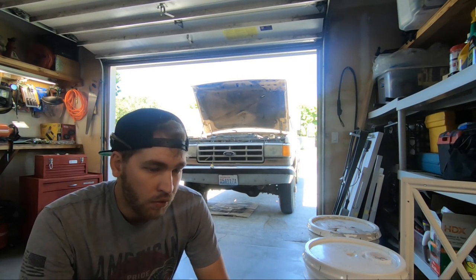Well, just taking that truck around the block told me a lot of things that I need to address on this vehicle. For starters, I noticed that the brake pads were low when I was bleeding the brakes, so that'll probably have to be addressed. But the brakes are fine for now. I'd feel confident enough to, like, say, take it to my local car wash and get it cleaned up. So the master cylinder was a good replacement, but probably the brake booster would need a replacement as well. For now, I'm just going to leave it.